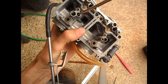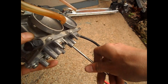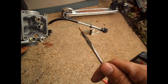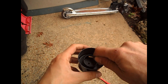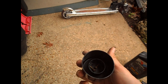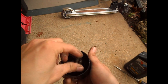Way down in there are the pilot jet screws. It's a lot like the main jet, just smaller — it's got the holes in the sides and whatnot. Stick it in there along with the other one, and the two pilot jets. They're going to soak.